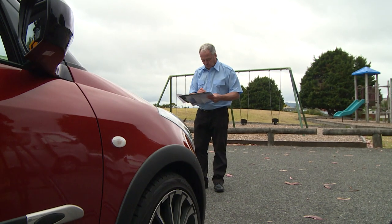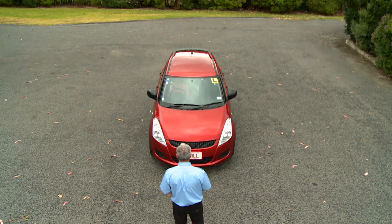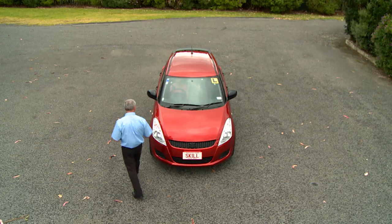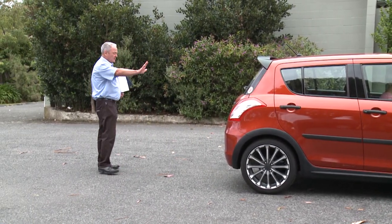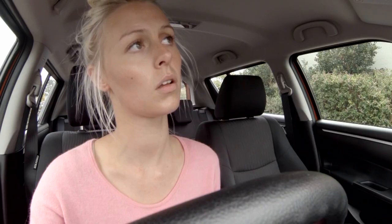After that, they go through a quick check of the vehicle itself. Is the bodywork in a safe condition? Is it sitting square on the road? If it's not, the tires may be different or at different pressures. Is the tread on the tires deep enough and is the wear even? Do all the indicators and brake lights work, including the high stoplight? Does the horn work?